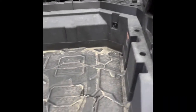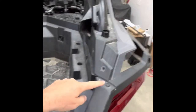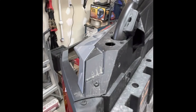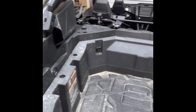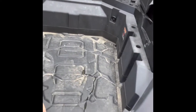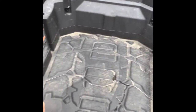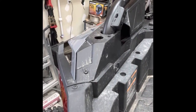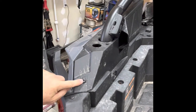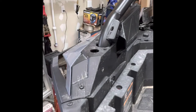The other thing you're going to end up doing is taking this bed part out. There are four bolts in it here — there's one here — and then this whole bed will come out. The reason we're going to do that is we're going to be wanting to run the wire harnesses up to the whips, running them back underneath here and tucking them away. So we'll get to that next. I'll show you how to take this off. Again, the Torx bolt here, two body pins — I'll show you how that folds up.